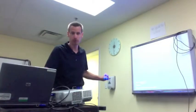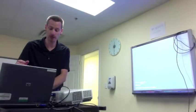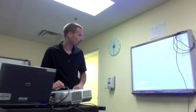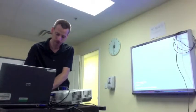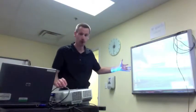You'll notice that what I'm seeing right now is blue — it's not actually what I'm seeing on my computer. If that happens, you need to do your function F key: F3, F4, F5, F6, F7, or F8. Hold down the function key and look along the F keys at the top, looking for something that says 'LCD/CRT' or has a line and a circle. In this case it's F4, and in a moment it should come up on the screen. And there we go. Make sure the image is not over on the outside of the screen.